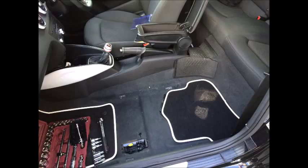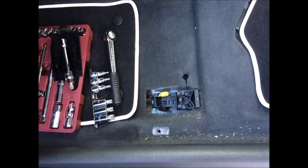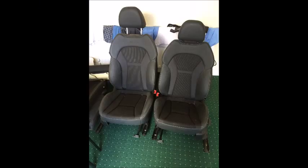Okay, at this stage, once you've navigated the seat out of the car, it's your opportunity to clean the carpet and give it a good vacuum. Then navigate the new seat into position, make sure it all nicely lines up to the 4 holes that you can clearly see in the car bodywork, and using the same bolts, screw them back in. It's really worth mentioning at this stage, you need to make sure that the bolts are extremely well screwed in. If they are not, when you sit on the seat it will rock back and forth on the roller and the runner slightly. So you really need to make sure that those 4 bolts are back into place very tightly.